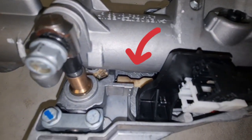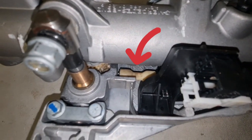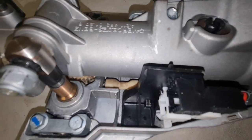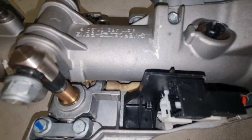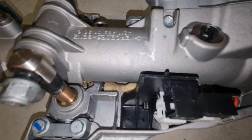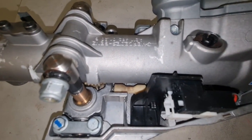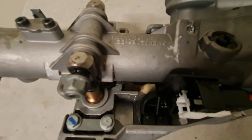The problem is that rubber flex — over time, after 10 years or more, because it requires constant flexing, it gets damaged and cut from the middle. In that case you will have your tilt motor running — you hear the motor running — but the gearbox doesn't get energized.